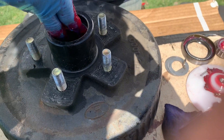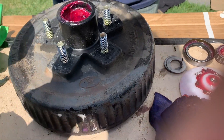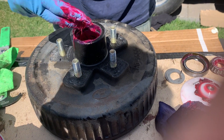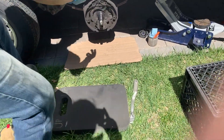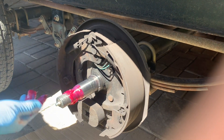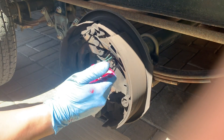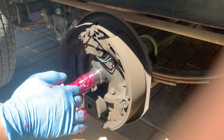Same practice on the other side — just put the grease in. There's no specific amount; the best approach is to use your fingers and put a healthy amount inside so it's completely lubricated. Over time it spreads across the axle area, but really I just need it concentrated here. You can see there's some pitting right here, which in general you don't want to see — it's not ideal, but not too bad yet. We'll have to keep an eye on that.